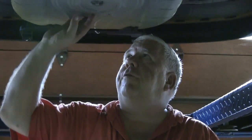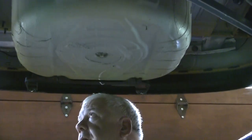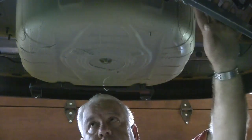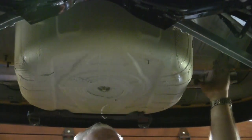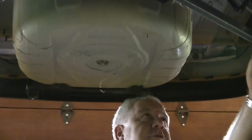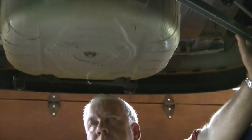While we're under the car, I'm going to turn you around from our gas tank position and talk about where the spare tire was. This comes down and we've actually got quite a bit of room behind here, rear of the wheels. This is where our rear suspension is, but I think we can build a box here about 35 inches wide and 21 inches deep, about 11 inches deep, that we can hang inside the cargo area — actually under the floor — and have enough room for an additional seven batteries and a Brusa charger.